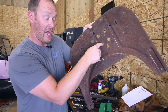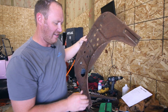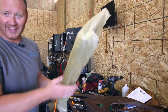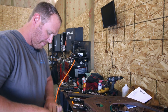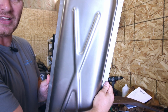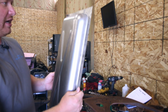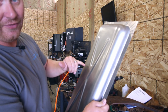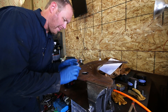For the patch panel here, I'm going to be using a 1931 Model A Cabriolet panel from underneath the seat — that's not a mouthful! What's super cool about it is it's got a beautiful dish to it. Plus it's even embossed, so it matches a lot of the embossing that is already on the firewall. I'll be cutting out the firewall, basically only using half of this — maybe from this line up to here.